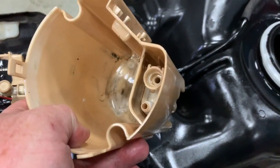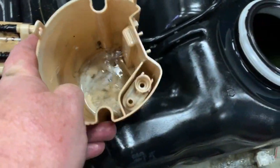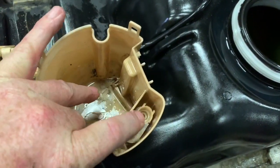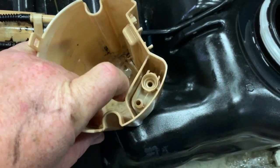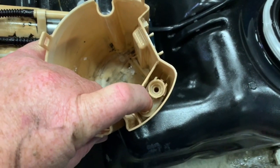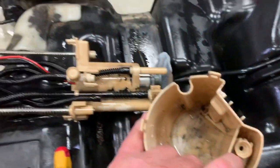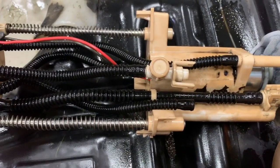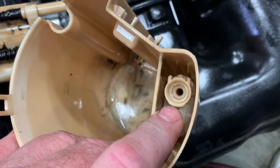I've just snapped the Venturi back down into the swirl pot. I'm not sure what holds it in, but it's fairly loose and I was able to pull it out fairly easily. There's an O-ring that has to go into that seat just in there, and then the other connector with the bypass valve clips into that. So I'll just do that assembly and then I'll take another photo.